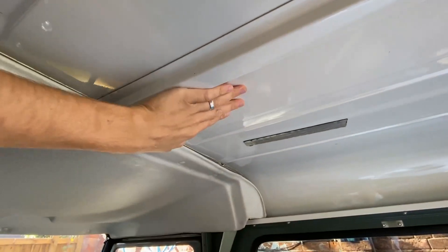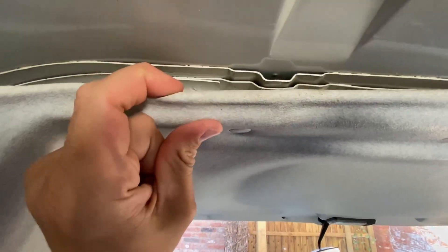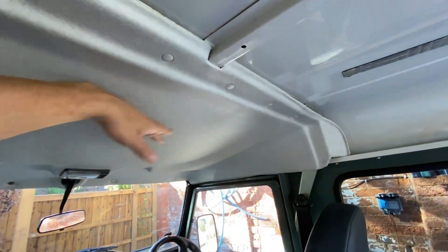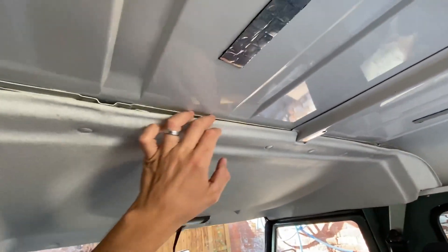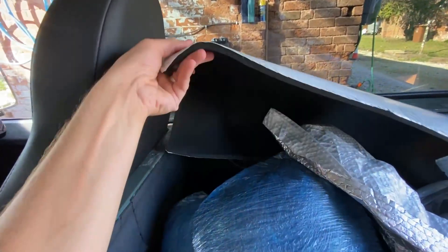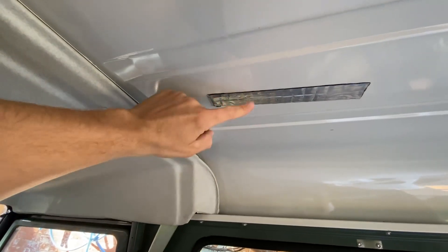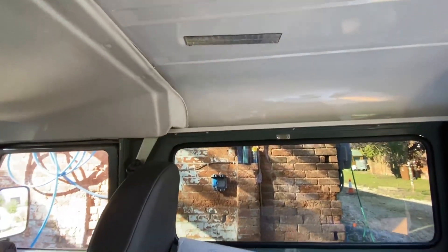This is not going to be the easiest thing to do. Let me show you the front headliner — this is the standard factory Defender headliner, a fabric cover headliner already fitted on the car. With the LaSalle interior you should really get a full one for front and back; I think it all fits better. I'm going to try and maybe cut it or slide it under these gaps, but that's what I'm working with. So I'm going to start by putting this Silent Coat on — I can't remember exactly what this existing strip is called but I'm just going to stick the foam straight over the top of it.